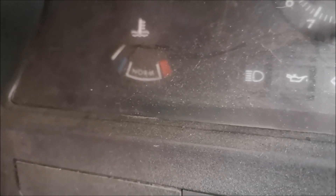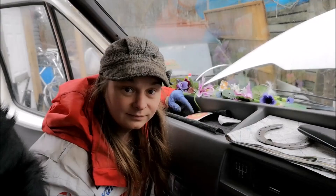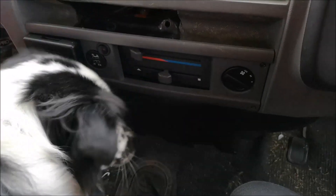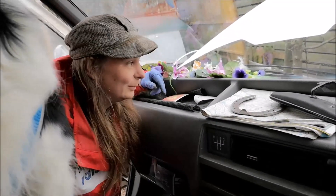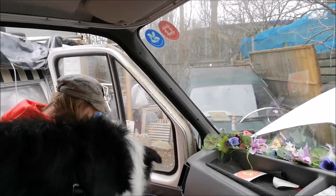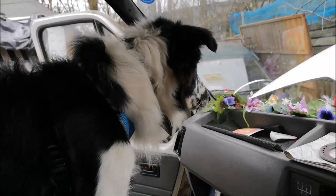So while the engine's on, I'm checking the temperature gauge — it's not gone up yet but it will. One of the tips is make sure that your heater is fully on so that you're opening up the whole system. Leave the cap off for a minute or two — let those air bubbles come out. I've just topped up again and we're going to leave it for another two minutes. Then I'm going to put that cap on to build some pressure up. Whilst Jack does all the supervising and inspecting, making sure everything's going fine.